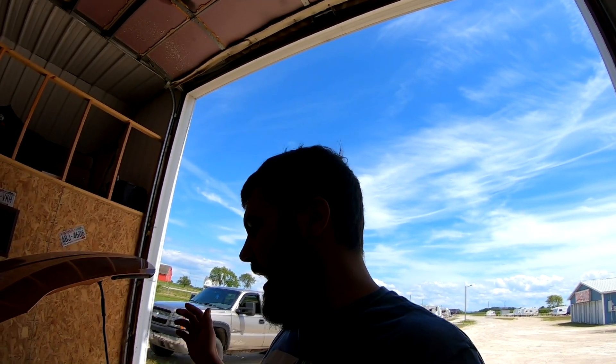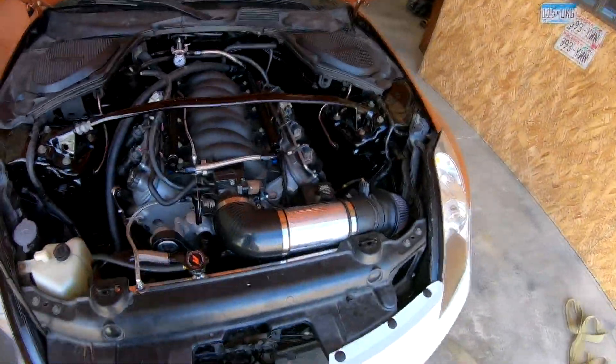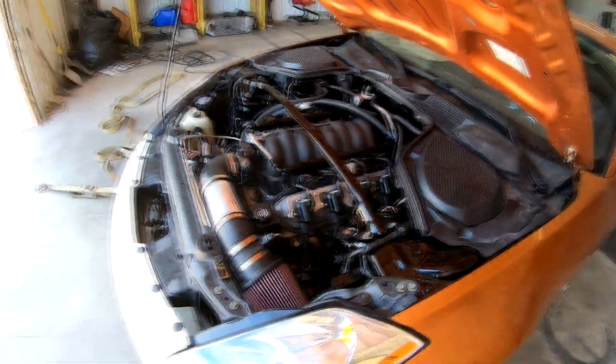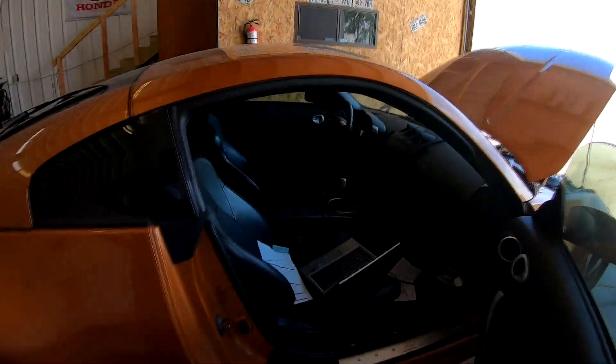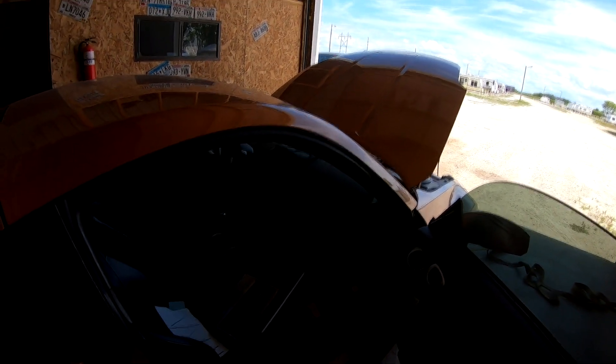After that fix, I was tuning and it would never come down to idle - it would idle hang. It ended up being the throttle position sensor wasn't calibrated right. The TPS was reading two percent when the throttle was completely shut. With HP Tuners and a lot of these cars, you always have to make sure the TPS is calibrated 100%, because it needs to be at zero percent to initiate idle mode in the computer. These GM computers have separate tables for idle airflow, idle VE, and idle timing, and those tables only activate when TPS is properly set.